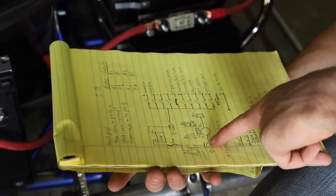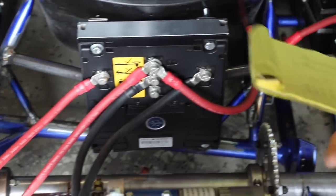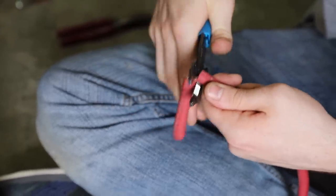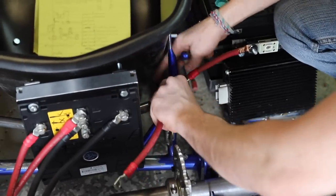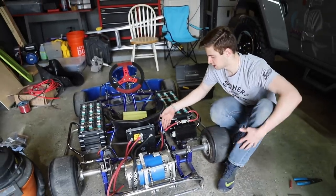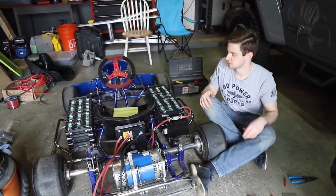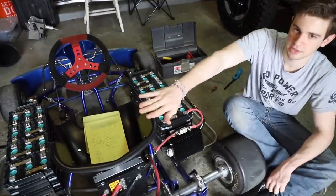B-plus also goes to the contactor. So now this contactor wire goes to the battery positive on our motor controller. If y'all don't know, the contactor is basically just a really big relay. Since this thing is running 90 volts, you need something a little beefier. We are doing all the positive wiring right now.